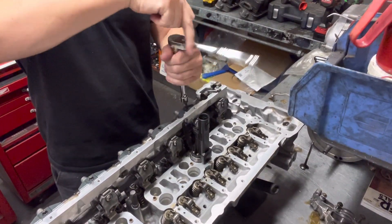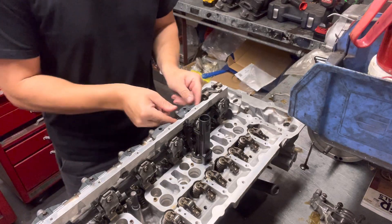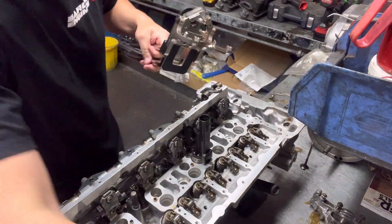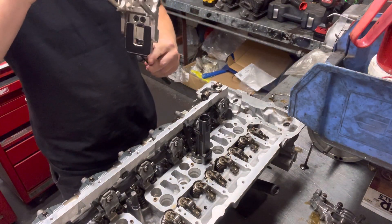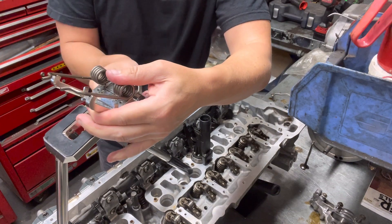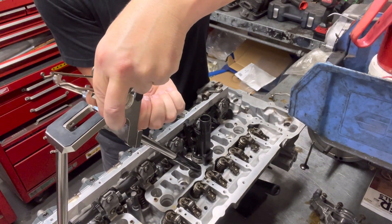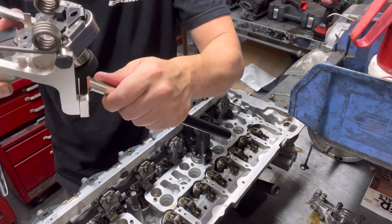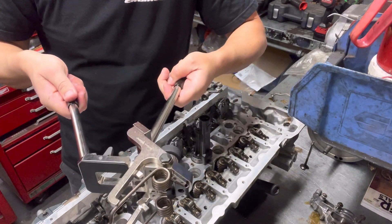So we take this one off here and we put the bolts in last. What we do is you've got the special tool here — we take the bolt out of the spring and we load the spring tool, pushing those legs into these two feet here. There is a nut at the back which we do up, and what that does is pull those two feet and hold the spring down in place. Then ensuring that these two legs are in the arms, we push the tool down and that compresses the spring.